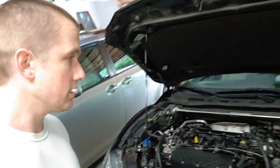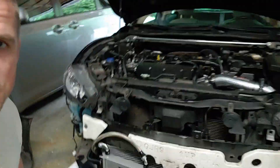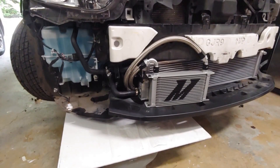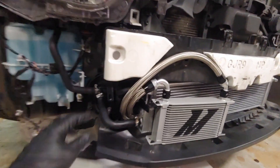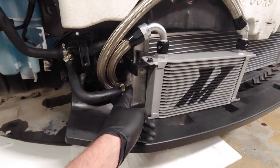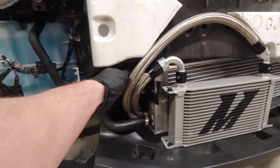Now, if you hear that background noise — a little whining — one of the parts that's been a challenge is working out a bit of a leak. I will flip things around and show you what's going on. I've gotten a lot of questions about the oil cooler and the intercooler. This hose right here, this fitting behind the oil cooler lines to the intercooler, seems to have been the primary source of a very slow leak.